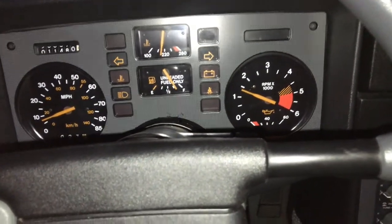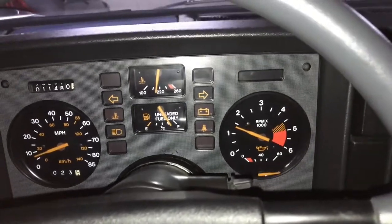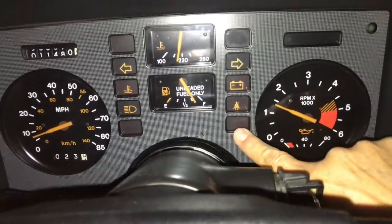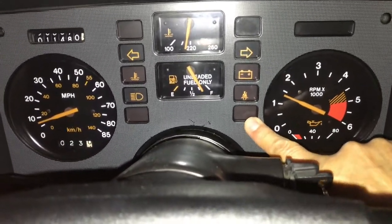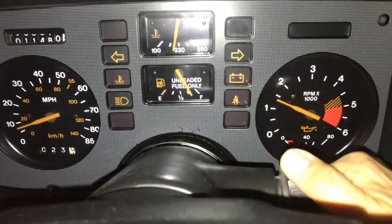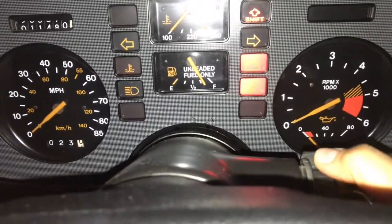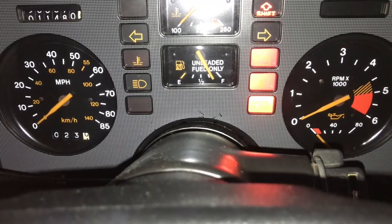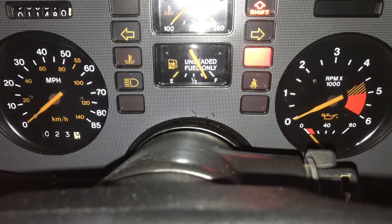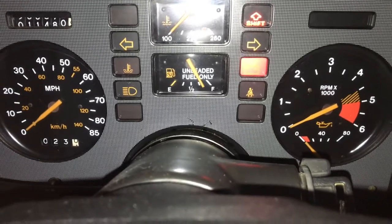Okay. Now that we have our paper clip in its spot, you don't want to turn the car on, but you just want to turn on the ignition. What we're going to do is look right here — the check engine light is going to start spitting out codes because now it's in the mode where it's going to give you codes. Here we go, let's see what happens. So it's giving me the code 1, 1, 2 — so that's 12. It's going to do it three times.